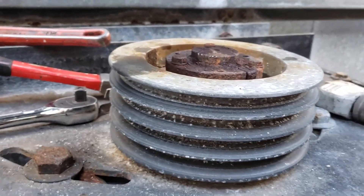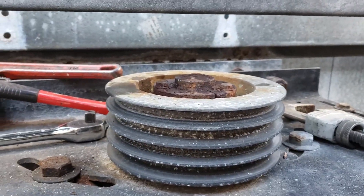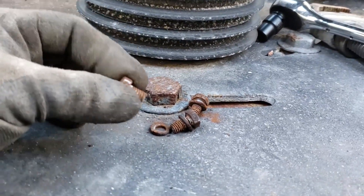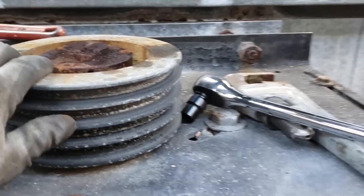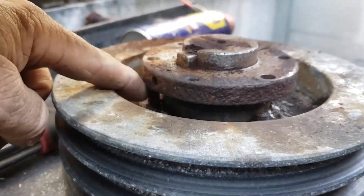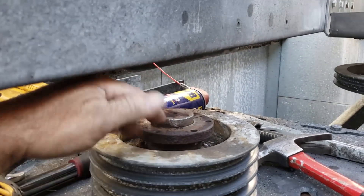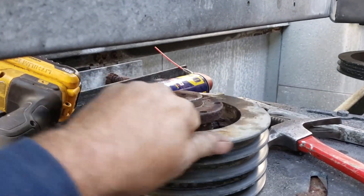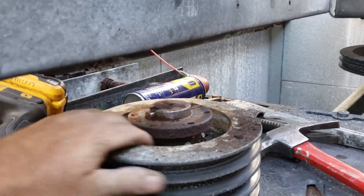I have the sneaky suspicion some of that stuff's going to start breaking. Yep, all three bolts broke, and all I used was a ratchet — did not use the impact. The threads broke and stayed down in there, but couldn't get the puller right here. So instead of pulling this up, I just used the hammer and kept tapping on here as I spun around, and it dropped off as I figured it would. I just got this pulled out with ratchet straps all the way to the end of the adjuster.